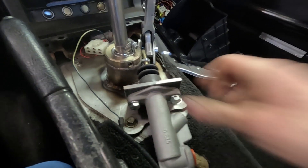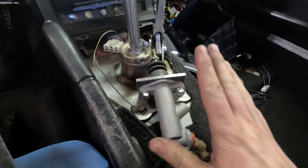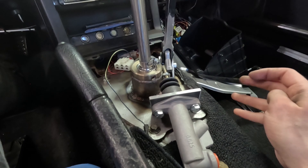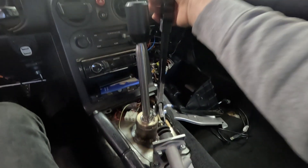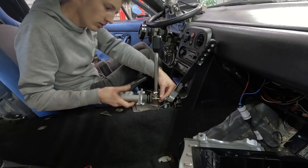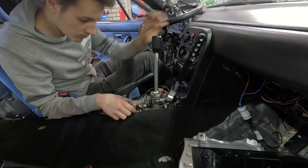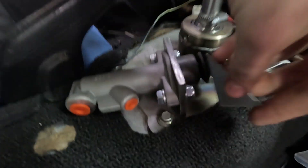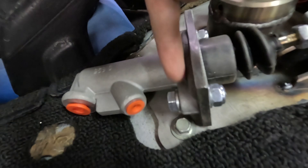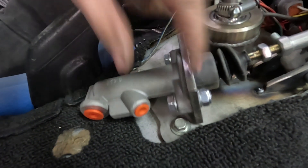Right here with some supporting tabs going in the back like that — we'll see if it can fit and where I need to modify it. According to my scans and my CAD, this will be underneath my center console; I might have to trim up some bits but we'll see when we get there. This feels crazy in my own car. It will be quite tight with the triangular piece in there too, so I'm going to remove this ring and weld it to this plate so it's easy to come in and out. Should fit right up — I'll mark it and then tack it.